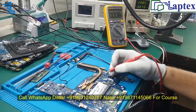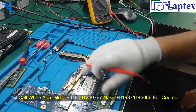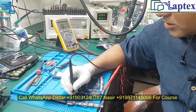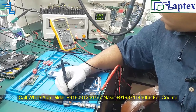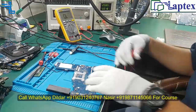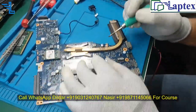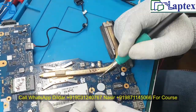Since the motherboard is not turning on by itself, the CMOS battery may be an issue. I am going to try to turn on the motherboard by touching the second pin from the right-hand side — and it is not turning on. So if you face this type of case, I would recommend first of all remove the CMOS cell. What happens most of the time is the laptop will turn on after this — it is called the reset process. Just remove the CMOS cell from the motherboard.